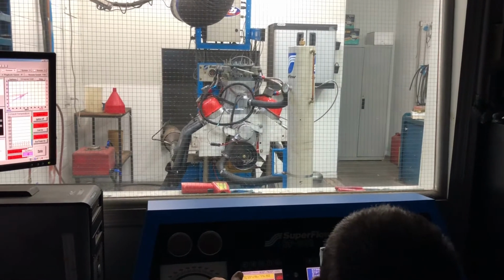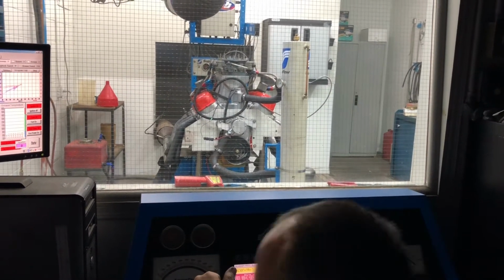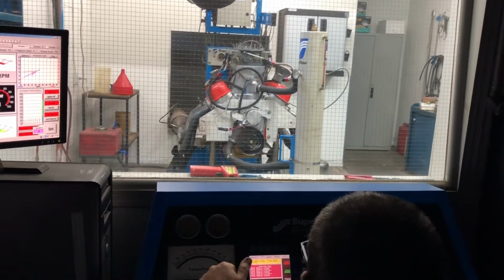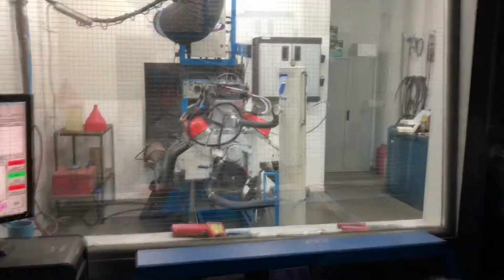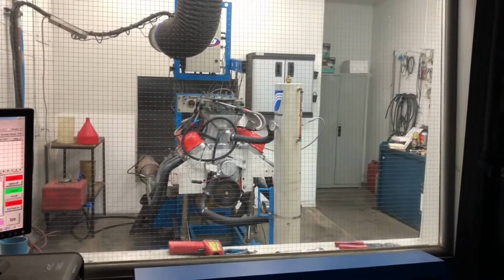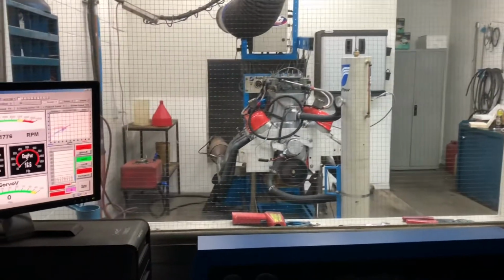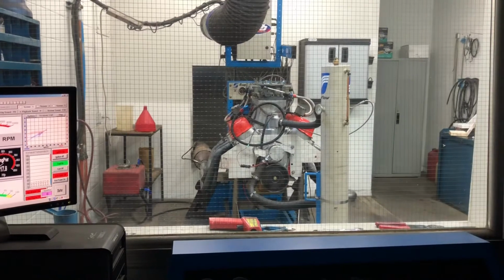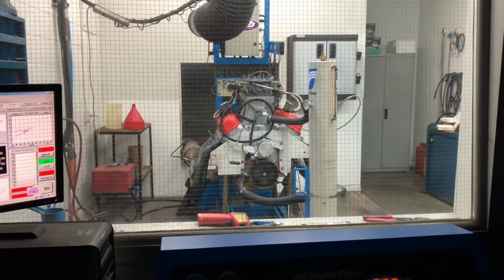Okay, let's check the height on the rear floats. Because they may be buried. All right, let's go check that. Well, that carburetor looks like it might be running over too. We went up 4 jet sizes in the rear. How many in the front? Three in the front. No, two in the front corner. We had 86s in the front, and I had 85s in the rear.